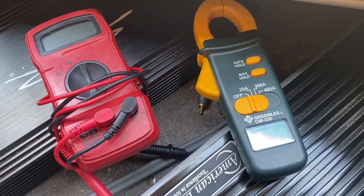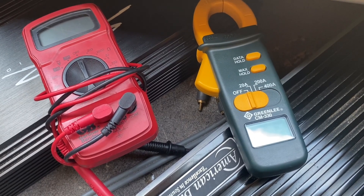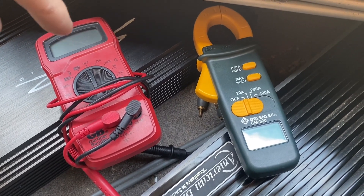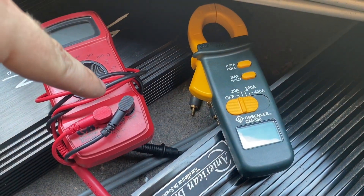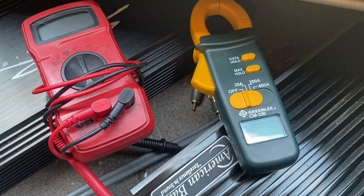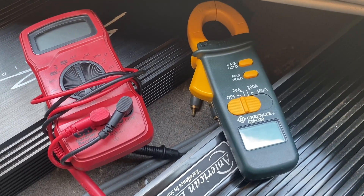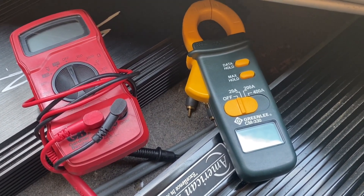That's on two subs, so multiply that by two — I'm only getting around 1420 to 1430 watts. Now to find what ohms it was playing at, to see how much box rise you have, take your voltage and divide it by your amps. When I do that, it came out to 2.5. So I know each amp is rising to 2.5 ohms, and that's why I'm only getting 715 watts.